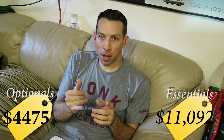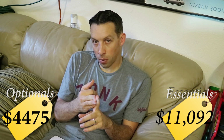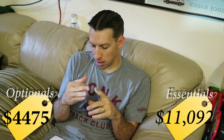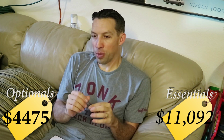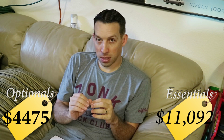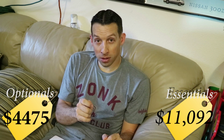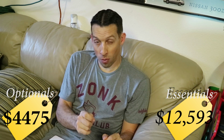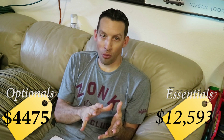Additionally, you're going to have to think about things like boost control, electronic fan control, continuous upgrading and expansion of your project, mass airflow meter sensors versus manifold pressure sensors. And for that reason, all of those things considered, I went with a Haltech ECU. Now the cost of the Haltech ECU was $1,501, but the benefits seriously outweigh it all.